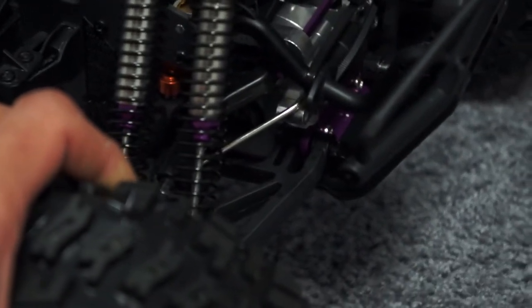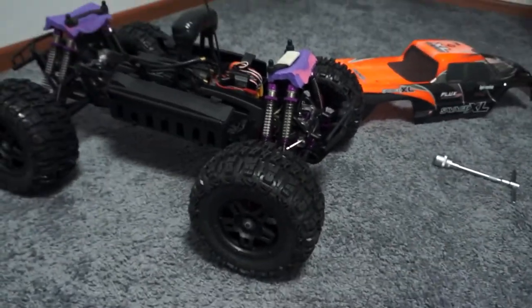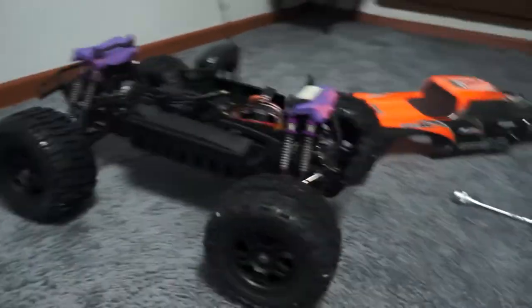So front is thicker because most of the load in a turn gets to the side of suspension which is in the front and outside. It's a part of a turn and the car tries to grip. So you want to keep both rear wheels contacting the road and the front just to stabilize. So much less stabilization is required in the rear.